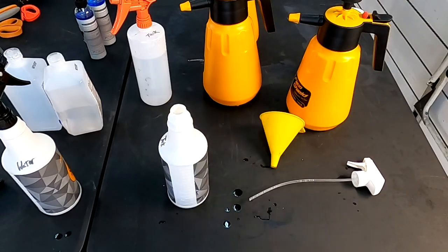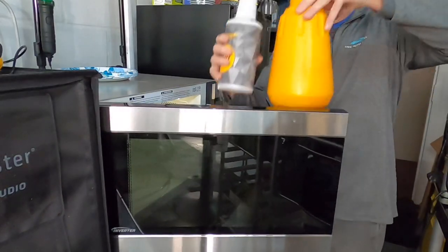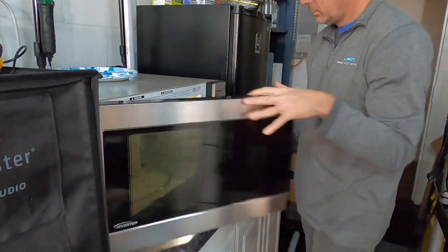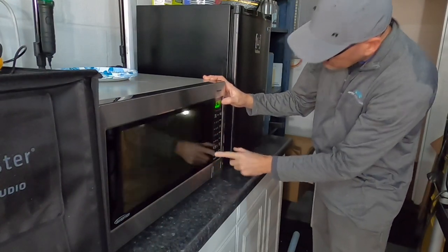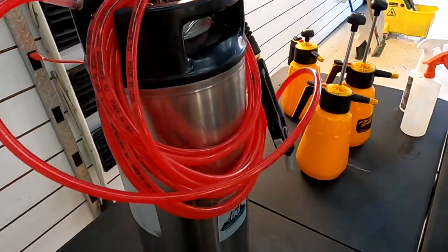And we're good to go when it comes to solutions. You want to have the heat turned up nice and warm in the shop. We also like to put the solutions, if they cool down, back into an oversized microwave for 2 to 5 minutes and get that water nice and toasty. What it does, guys, is it keeps the film pliable. It keeps it easier to work with. Everything seems to just work so much better with the warm water.